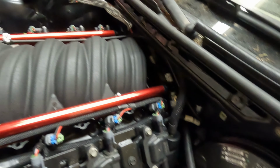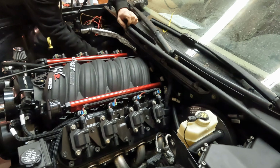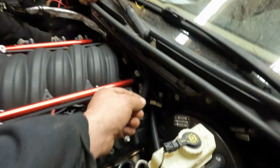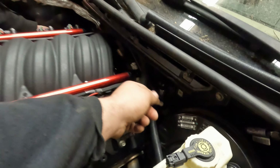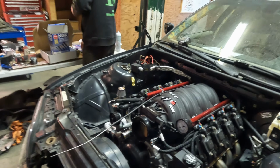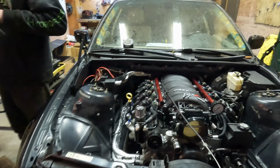Fuel lines are all ready to be hooked up, but because I made all these new AN lines, I was kind of worried about just hooking them up. So I got some fittings to go into these AN lines and some hose, and I'm gonna blast them out with gas before I start up, because I don't want to plug up the freshly serviced injectors. And yeah, I think on the next video we're gonna be firing them up, boys.